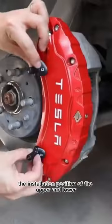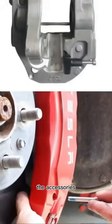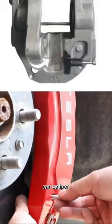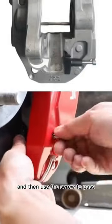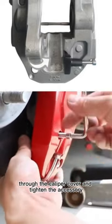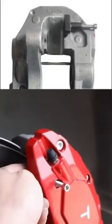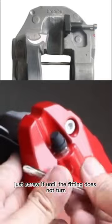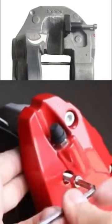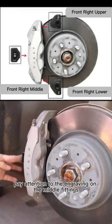What I did to fix this issue was physically watch to see if the threaded holes on the ABS molding align with the hole on the cover. I suggest turning the steering wheel so you can get better access to the brake. I also recommend installing in a good light setting. After physically watching and aligning multiple times, I was able to screw in the mid-bolt.